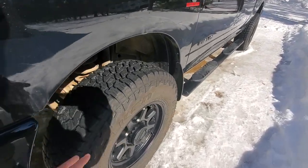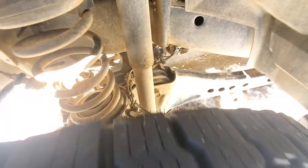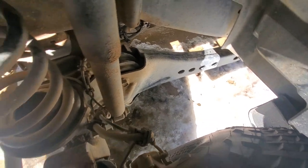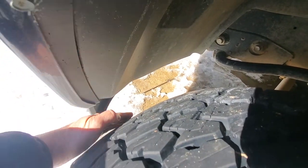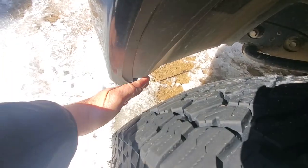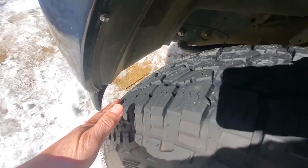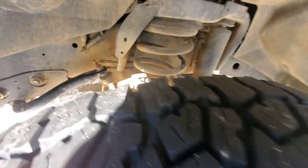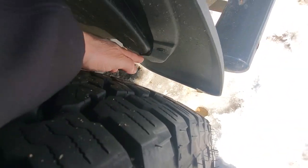Tire-wise, when you start looking at your tire sizes, you have to take into account that you will have clearance on all your suspension components. When you turn and go into full lock - when we turn this wheel, we are coming right in there close. We're not hitting, but we are close. So you have to take into consideration, on a stock truck or if you're lifting, what you can do to make sure you clear all of your suspension components. When we turn this wheel in, it comes right next to there.